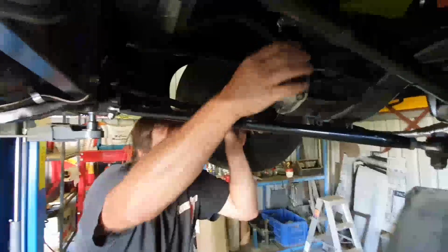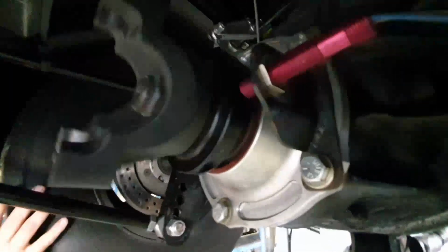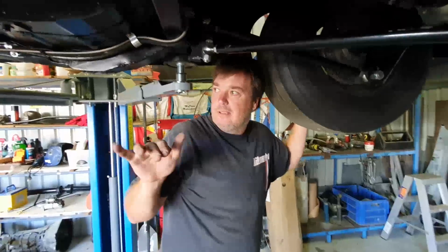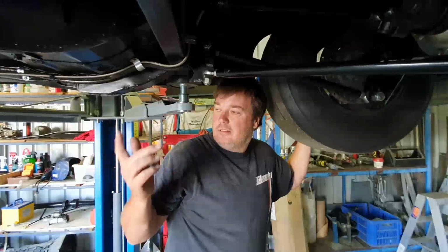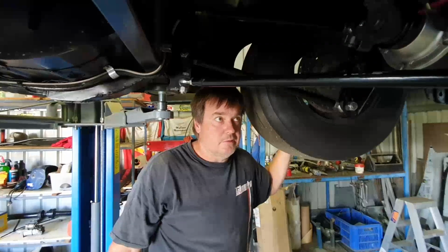The other thing is we've added a wheel speed sensor to the back here. So that's got magnets on it, a little magnetic pickup goes to the logger. And we were having problems with bumping the car into stage. It was starting our boost curves and our timing curves. So we were blowing the tyres off and wondering why. That's because it took us a couple of runs to work out that it was the bump box